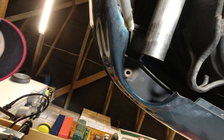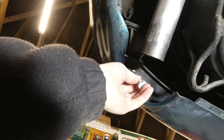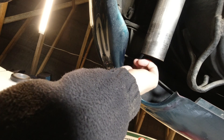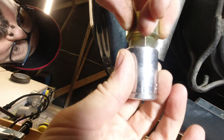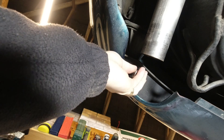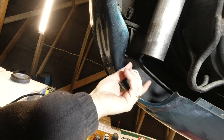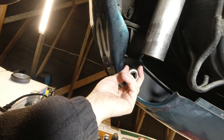It does present quite an issue and a challenge to get a bumper off if the nut is effectively spinning around on the other end of the bolt. So smear some copper on them, start them by hand, and then tighten using a 21mm socket on the adapter key. As you can see this is a relatively straightforward job that you could do by the roadside without a lift and without removing the end of your exhaust system if you've got the standard exhaust, which is rather narrower and you can easily deflect it out of the way to get good access.